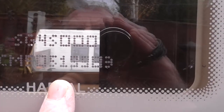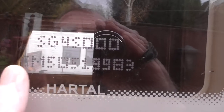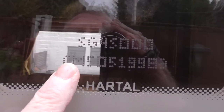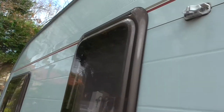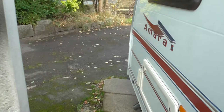The way to date a caravan is by these numbers on the windows — this is known as the CRIS number, which is also the chassis number. To find out the date of manufacture, you count the tenth digit in: 1, 2, 3, 4, 5, 6, 7, 8, 9, 10 — that brings us to the number 5, which means the caravan was made in 2005. There are all the manuals in the caravan for the appliances, the motor mover, and the National Council certificate.